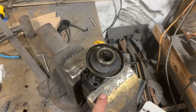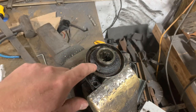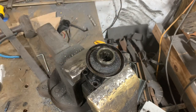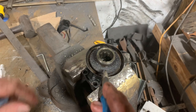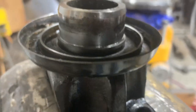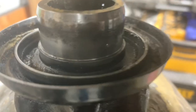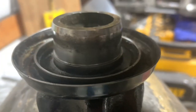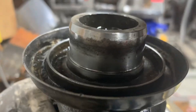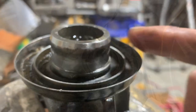I've got the yoke in the vise now. You can see this is the felt seal on the outside that catches any little oil that sneaks past - and it is just soaked in oil. So if it wasn't already leaking, it was about to. I'm going to pull that felt seal off and get it out of the way. You can see all those little pits and how the surface has just worn over time from sitting. All those little divots are where the oil is getting around. I'm going to show you how to clean that surface up and give it a brand new seal surface.